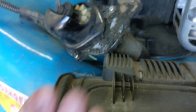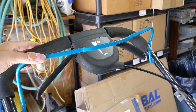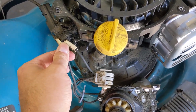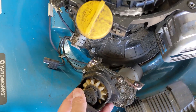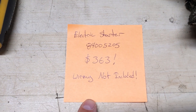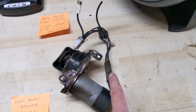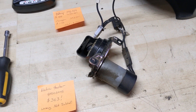You can put those bolts into your bolt bin because there is no heat shield or anything else that those starter bolts hold on. You still use the control lever to run the engine and then let off to stop it, and it does have its own kill switch for grounding the coil at the back with two female connectors on wires that you can simply unplug from the spade terminals. You can then disconnect the terminal that goes up to the push button start — we have now successfully separated the electric starter from this engine. This electric starter, part number 84005205, lists for $363 here in Canada, and wiring is not included. I could easily sell that for $100, so that's definitely going into a parts bin.